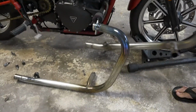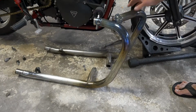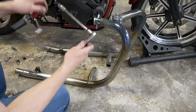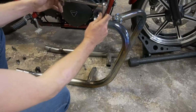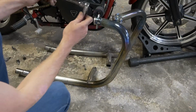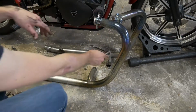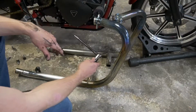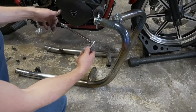Alright, we cheated, did a little movie magic off screen. Once I got that clamp out, taking a extension, 3/8 drive ratchet and a 6mm hex through the hole in the skid plate. And only one of them, because an oil tube blocks the other hole. There's really only one way to do this. You could take the skid plate off, that's 2 ways.